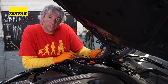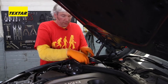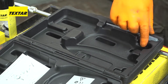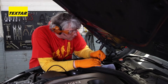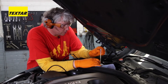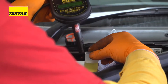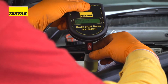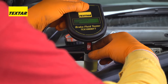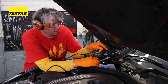Normally you would place this into the reservoir, but on this particular BMW there is actually a kind of grid of plastic in the way. They've obviously thought of this, so what they've handily supplied is a little pot and a pipette. I'll just go in and take out quite a bit of brake fluid — probably about three quarters full. Then I just pop our little machine in, make sure it doesn't overflow, hold this down, and you can see it's starting to think. What it's actually doing now is warming up the fluid to find its boiling point, and you can see it's just counting up.